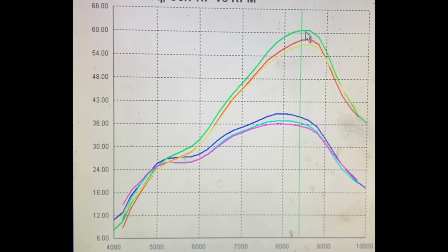We also did it with ignition timing. Right now, I have the stock YZ400 ignition box in it with the stator plate advanced as far as it'll go, which in this case is 6 degrees. We tried backing the timing off just to see if it liked that better, and all 3 heads liked the timing maxed out at 6 degrees from where it normally is. We do plan on getting a programmable ignition box in the future so we could better optimize this ignition curve. I would expect another 1 to 2 horsepower from more optimized ignition.